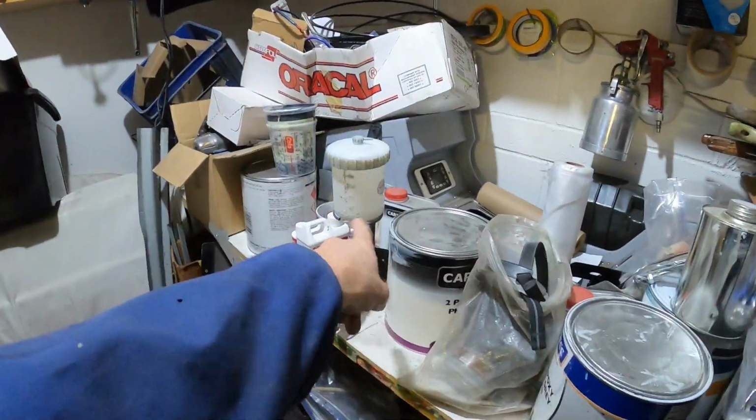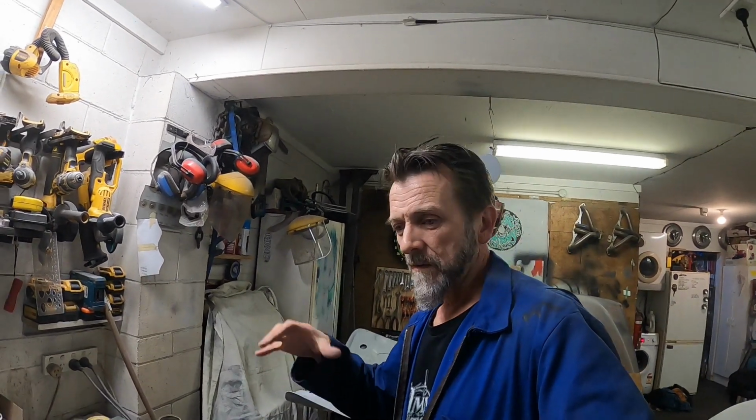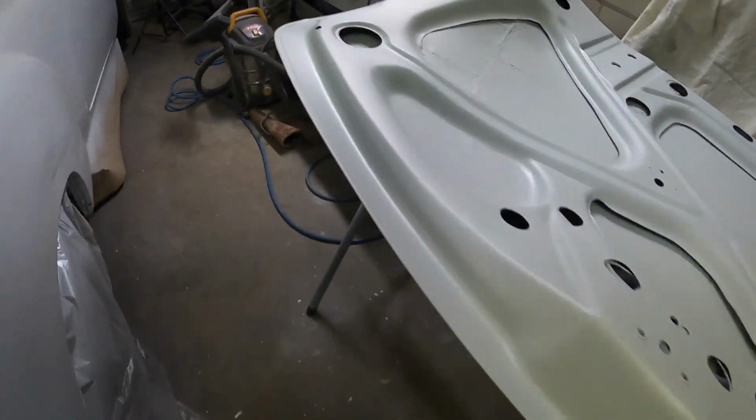The other thing, I'm not sure if I mentioned it or not, but that spray gun that I was using, that one there, on the whole it actually sprayed alright. When I first started spraying it out, it had a wonky fan, which could be to do with when I was trying to take that inner brass thing off. I was using some circlip pliers and managed to damage it slightly. Or it could be where someone, not me, Neil, used some channel locks or poly grips on that threaded part and maybe damaged it properly. It could have a slight leak on that brass part, but for a primer gun, it actually laid down alrightish, I think.